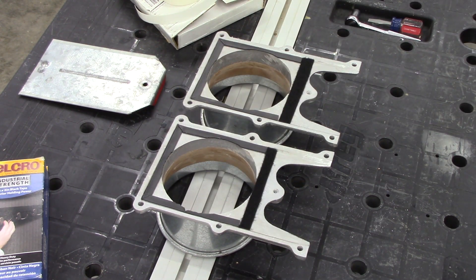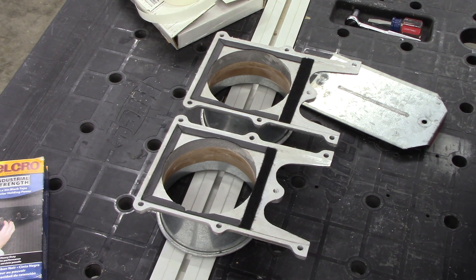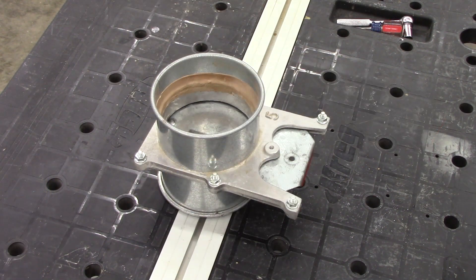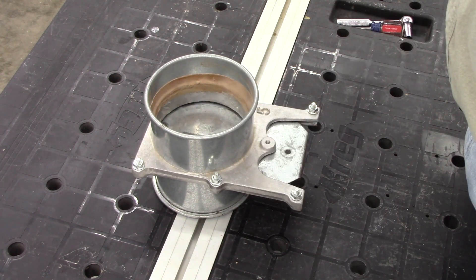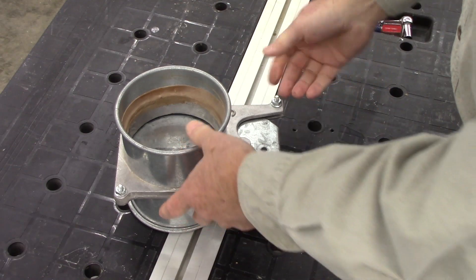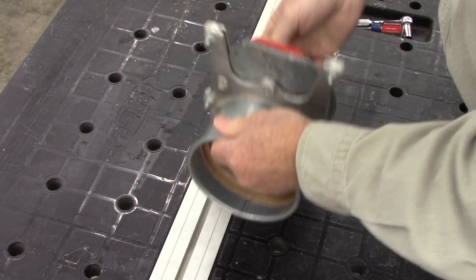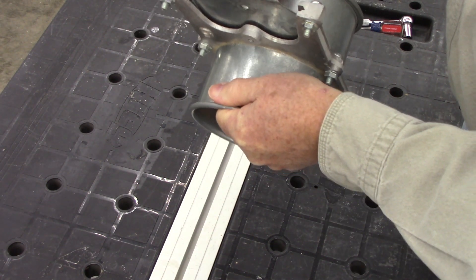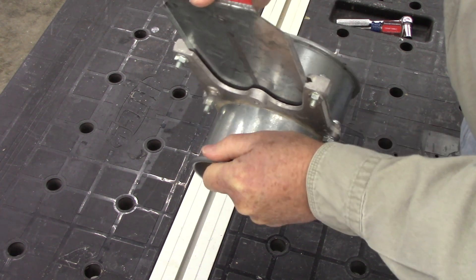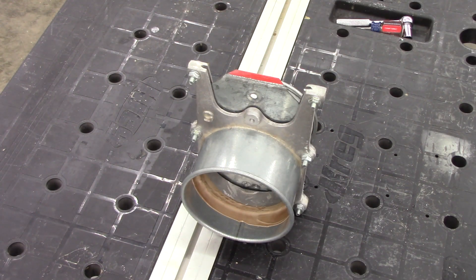I'm not associated with anybody and I don't have any affiliate links - these are just the products I use. Now I'm going to reassemble this gate and show the operation. Once reassembled, first check that it operates smoothly - you don't want to be fighting it. This one was pretty successful: there is absolutely no gate rattle, and you can see it's pretty much centered. Another check is to angle the gate to one side and make sure it still goes in smoothly and closes fully.